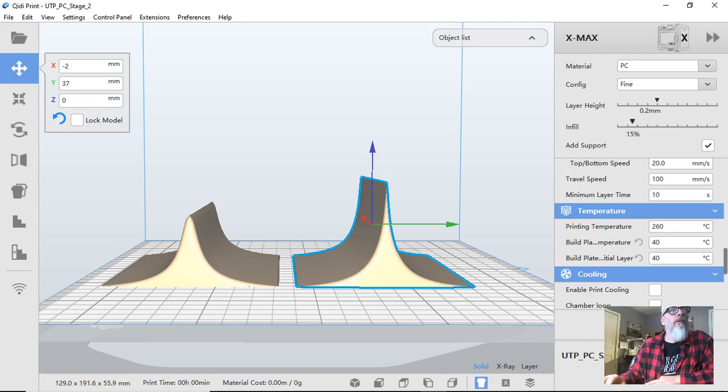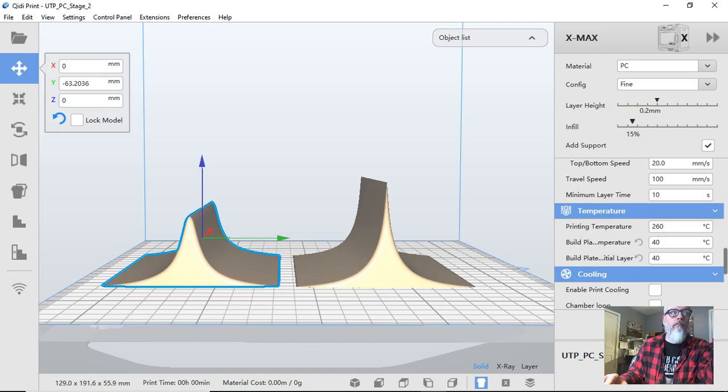Basically 1500 to 3000 RPM is where the stage 1 really performs. So we're going to offer a stage 1 and a stage 2. When you send an intake manifold in and you do a stage 1 setup, you're going to get this one included with your VRPs. The gap from here to here is 1.2 inches for the air to get through; the gap for the stage 2 is going to be 2 inches. When you send your manifold in for a stage 2, we're going to start offering this one here. I set the runners on a stage 2 based upon what the customer is doing.